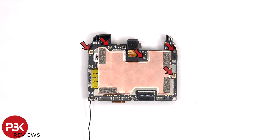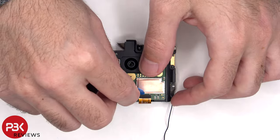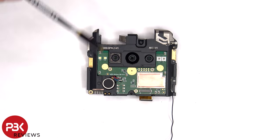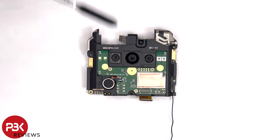There are five Phillips screws which are holding down the main board to the back plastic assembly. Once those have been removed, the flex cable connecting the main board to the back board needs to be disconnected. This plastic assembly can then be lifted up, and since the vibrator motor is soldered to this board you have to carefully pry it off.